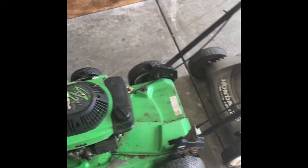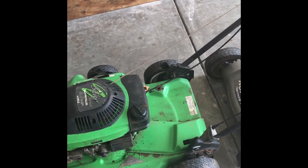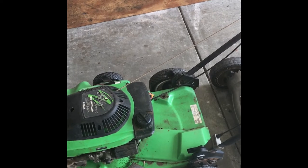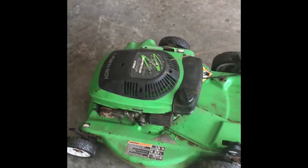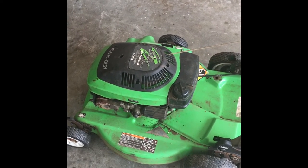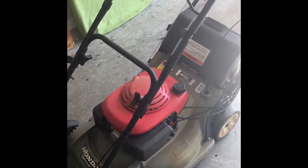And I sharpened the blade, and I had to fix an oil leak on the oil sump where the two halves meet. There was a leak in that seal. I fixed that with some RTV and then pushed it back together, and it hasn't leaked since. And I think that's it. I'll bring you in on some of these tidy up type things.